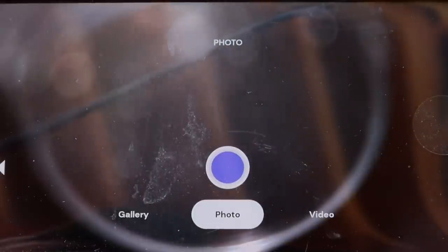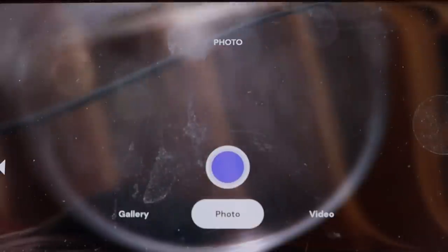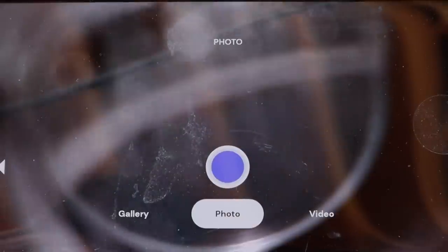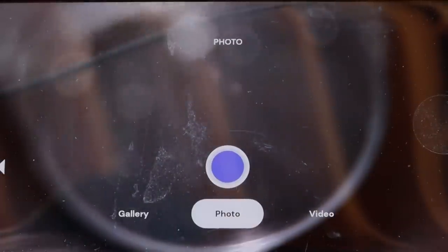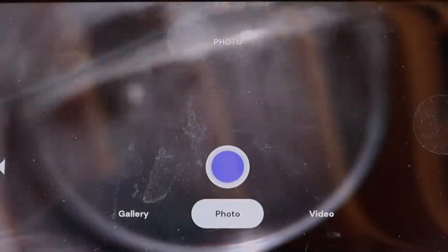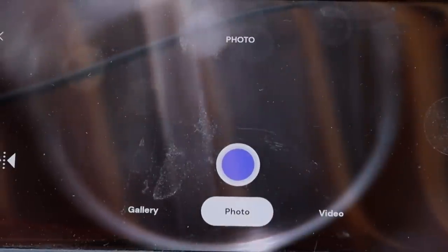So we're in the throat — there's our lens. And right now I don't even see that big ugly one that sticks up almost to the end. That's a good sign. It really must have been just barely showing up, and it's just covered up with carbon now I guess. Let's see what else we got — what's the copper looking like? We got a little copper now, a little fouling. A little darker from the carbon.